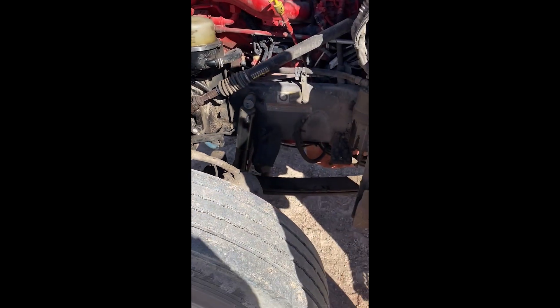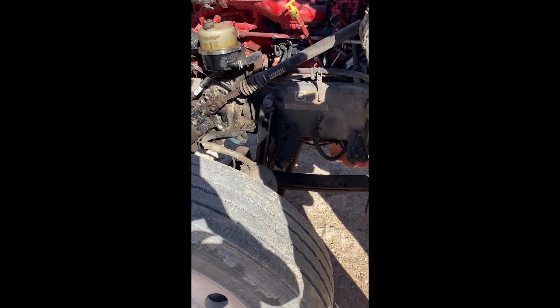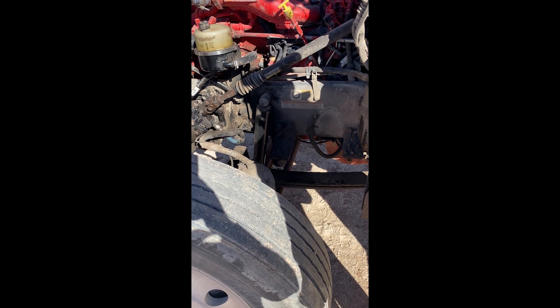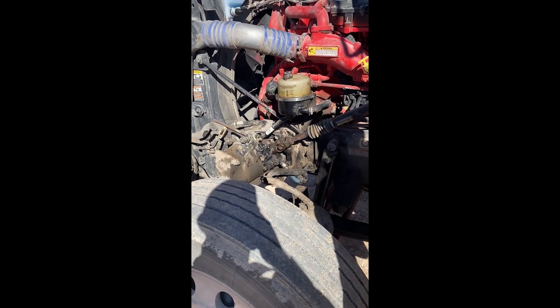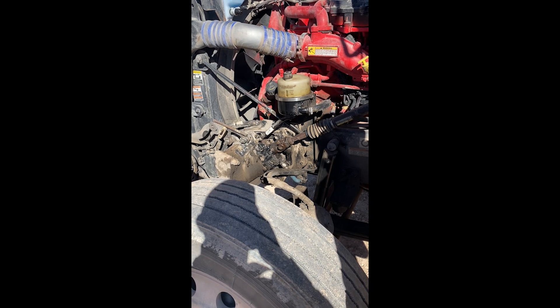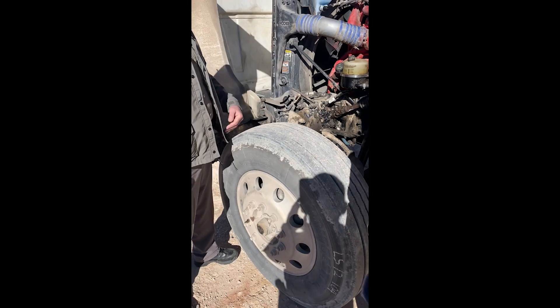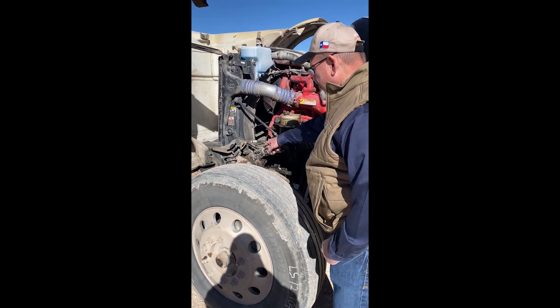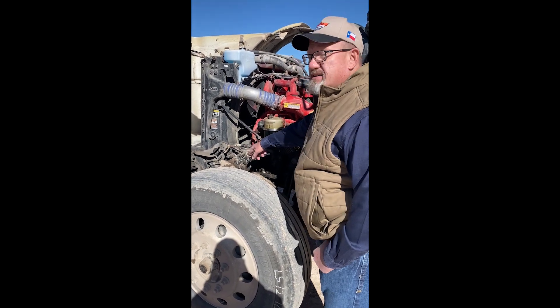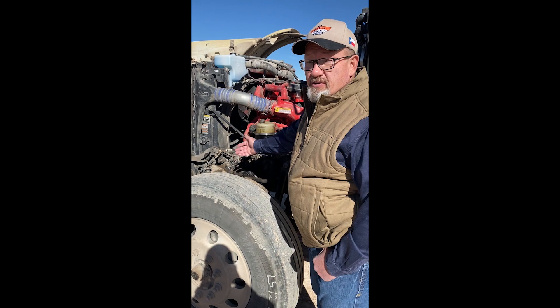Looking underneath at the oil pan — is it dripping oil? There may be some oil present, but if it's not dripping, no big deal. Same with power steering fluid — if it's not dripping, that's okay. Working out here, same thing — we're looking at wheels. Another thing that catches your attention: if your pitman arm is real bright and shiny, that's evidence that the tire is rubbing on the pitman arm.